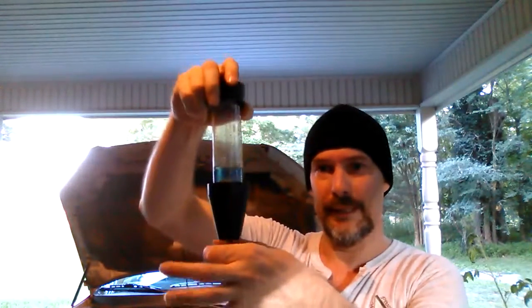We are finished up with that test and it is nice and blue still. We did about 50 or 60 pumps total. Whenever you put it inside the coolant reservoir, the suction gets so tight that the plunger no longer plunges — you squeeze it and it doesn't pop back out. You have to pop it out, slide it back in, and pump it again — about five or six pumps each time. Thanks for watching.